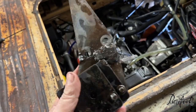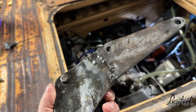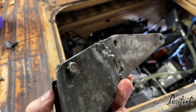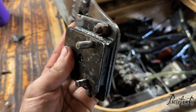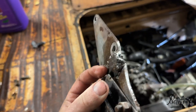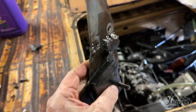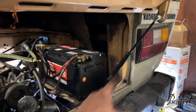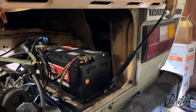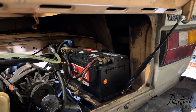A good example of what we're dealing with on this car: this exhaust bracket has clearly been cut in half, welded back together with a stick welder. This isn't the correct mount, but to get it to mount at this angle they filled it all in with stick weld, and because it kept breaking at that crack they just added more. It does function so I'm gonna do nothing, which is the right decision. Replacing this strut with one from McMaster - it's not quite right but it's the right lift strength, so the hood goes down and goes up, just not on its own. About 20 bucks.